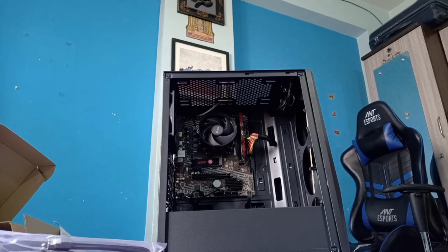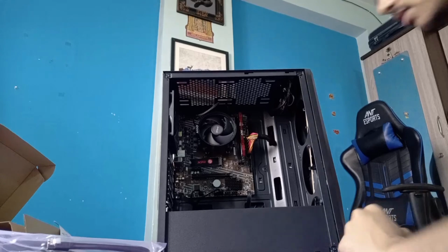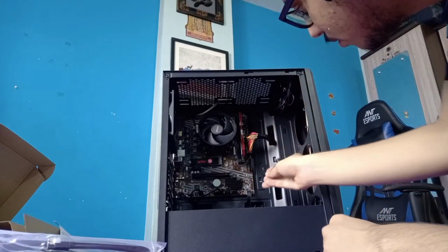Okay, JFP2, as I just looked up in the video, is the place where I need to connect the speaker, the buzzer, whole thing. So here's the connector, the small connector. There it is. Plus goes here. Okay, I got it. I need to install it. JFP1, minus is on 1, so plus is here. So this is how I should install it. Yep, there you go.